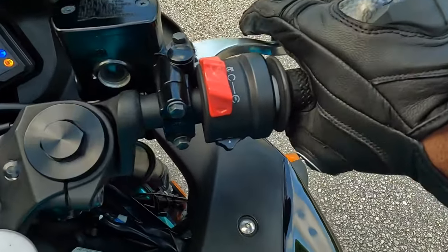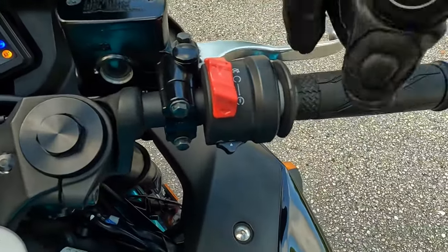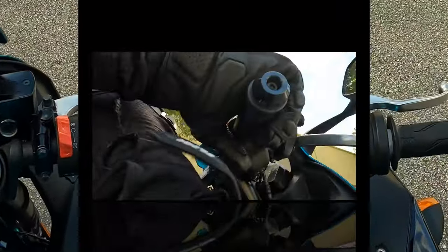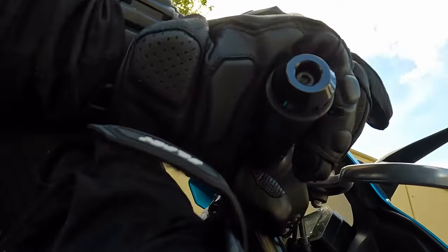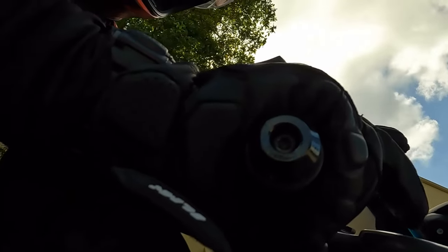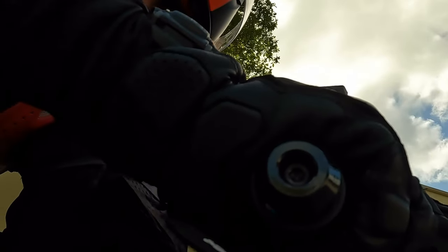The most important piece is you want to be able to reach your front brake without having to release the throttle and dumping the whole entire thing. My thumb and finger are here, my pinky and ring finger are here, and the rest of my fingers are up here. My pinky is holding it and I can release slowly on and slowly off — you see that.